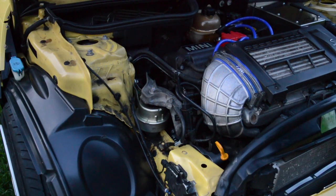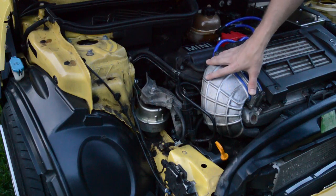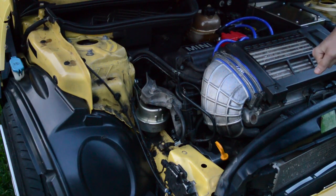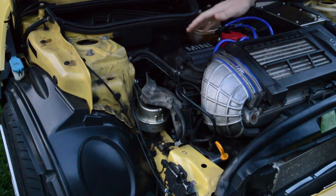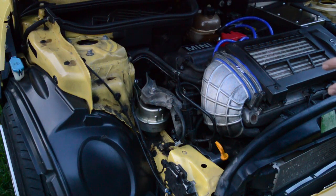Now unlike some install videos, I only jacked up the front of the car and put it on jack stands. But if you do that, you're going to want to watch how the engine is oriented. It shifts a lot when you have it more at an angle, and when you push up on it, just make sure that you know where it needs to be when you're putting it all back together. It'll help the bottom bolts all line up — it sounds self-explanatory, but it can become a pain because it's so heavy and at an angle.